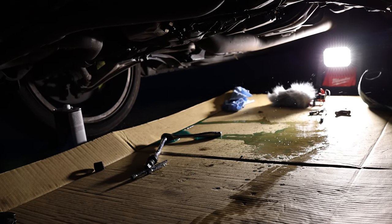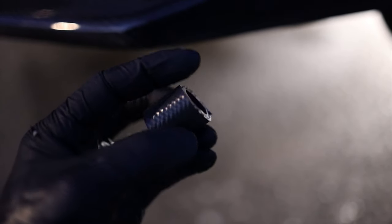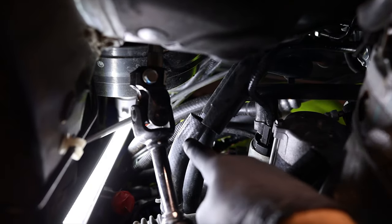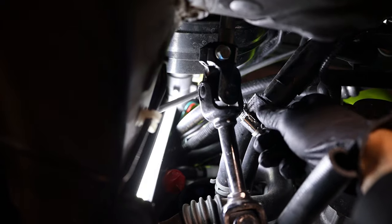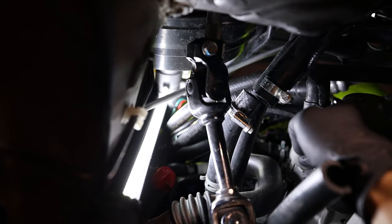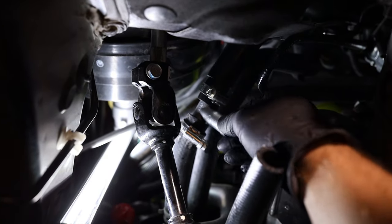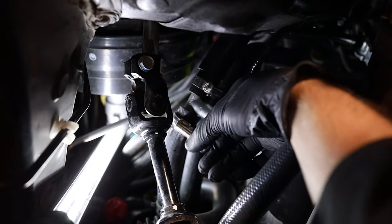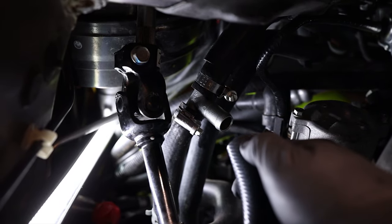For reference, I cut about an inch off the cylinder 4 cooling mod hose. I took the insulation off one side of the cut hose. Now get hose clamps on both sides of the cut, insert the metal T-fitting in the middle, and tighten both clamps down. Face the T away from the steering components so the hose runs in a clean direction. Tighten all the hose clamps down, then add another hose clamp on the cylinder 4 cooling mod hose and connect it to the T.